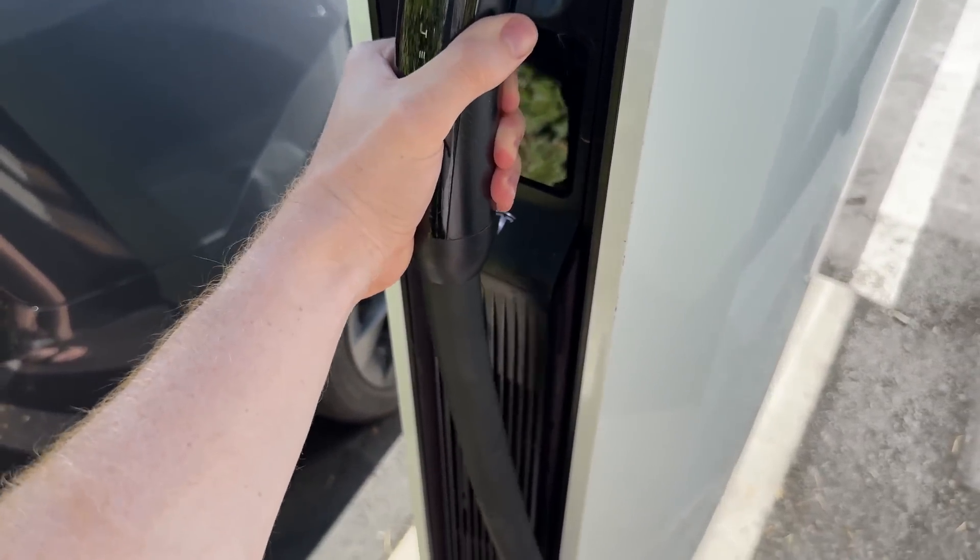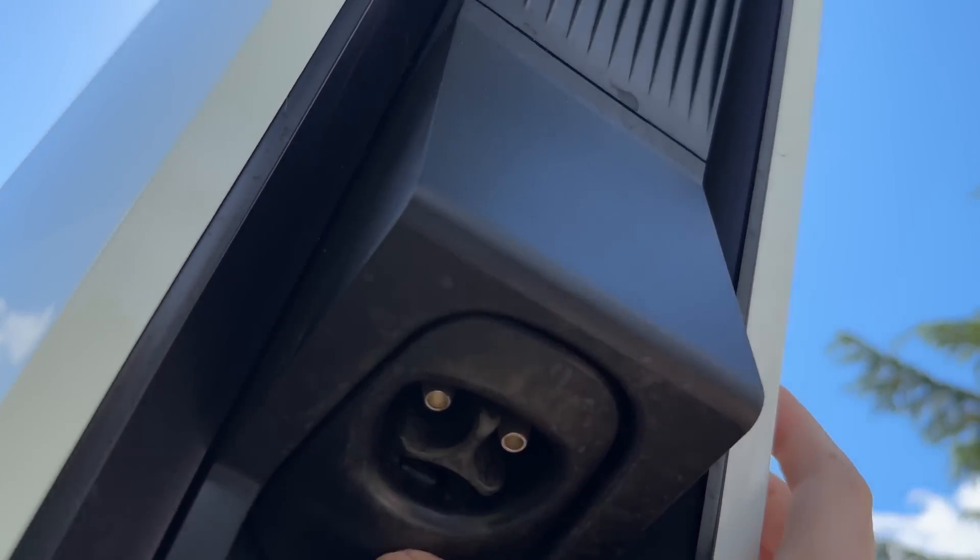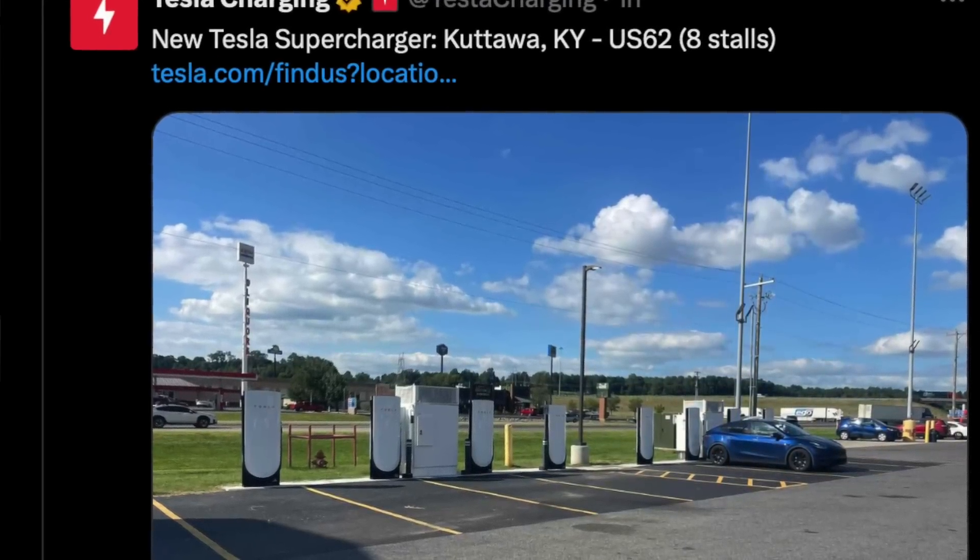The more efficient way to charge the Cybertruck would be for Tesla to actually roll out true V4 superchargers upgraded at both the cabinet and dispenser level. But this experiment makes me wonder if Tesla has discovered that V4 cabinets are way more expensive, and they're trying to keep infrastructure costs as low as possible — building out V3 cabinets for pennies on the dollar. Maybe Tesla is willing to eat some of that charging loss and deal with the extra heat and energy loss if it results in a substantially cheaper charging station. If so, in a few short months Tesla could be fast charging Cybertrucks at well over 300 kilowatts at these V3.5 stations.